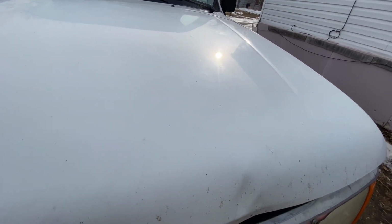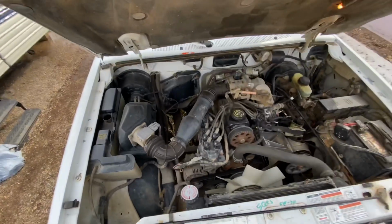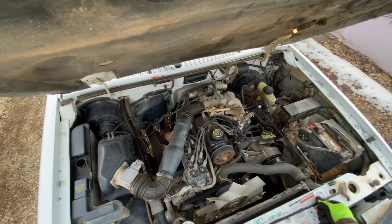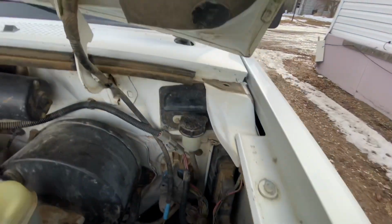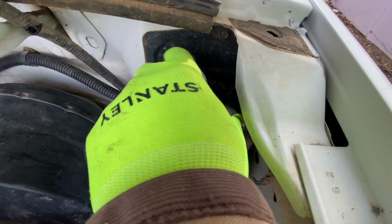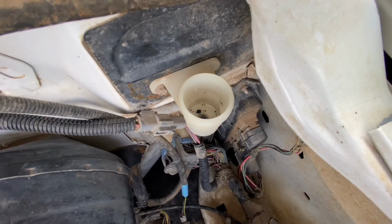And guys, just be careful. What I did is on the clutch mechanism. Please don't try to do this on your brake mechanism. On older vehicles, it's the same hydraulic fluid that would be used for the clutch and the brake mechanism. This one I consider non-critical. So please don't try to put this in your brake system, because you could step on the brake and lose all braking capability.